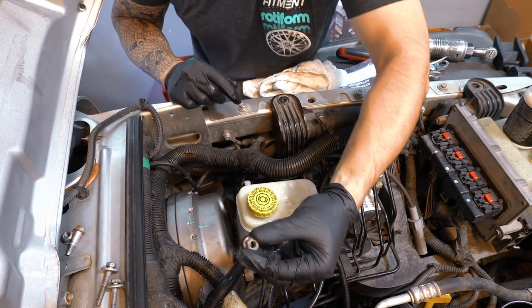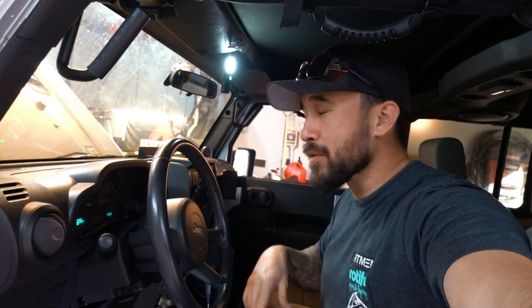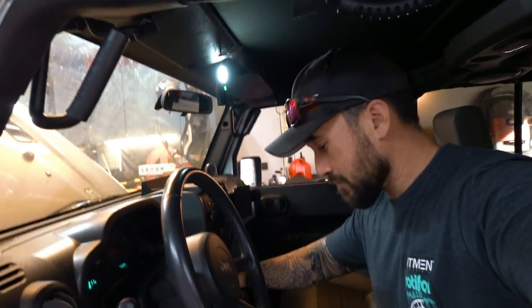Now that we got that, I want to make sure the seal is seating down there - not sticking out all wacky or anything. Push it on there a couple times - it's all good. Then put the two nuts back on and hook up the vacuum line. We got this thing all buttoned up - let's start it up and see what we got. Take a listen at the pedal and see if we got the brakes back. I don't hear any hissing, feels pretty good. Need to go on a test drive to verify it's all good and that the brake switch still works.